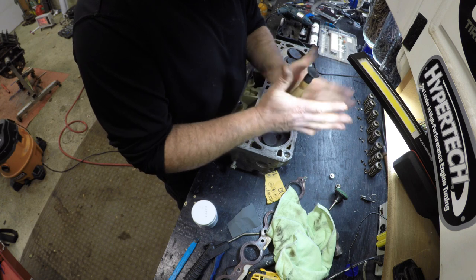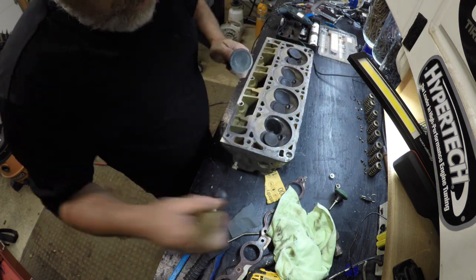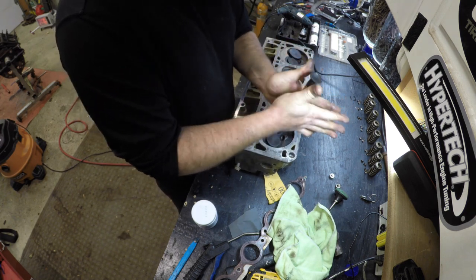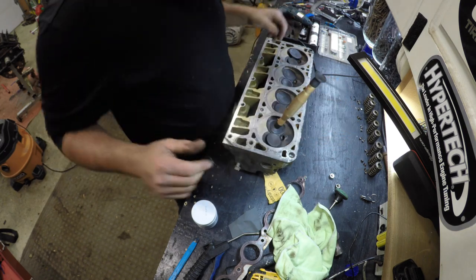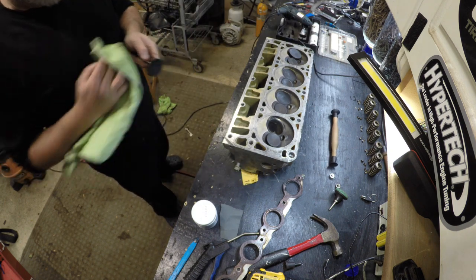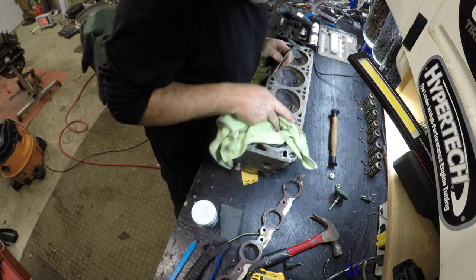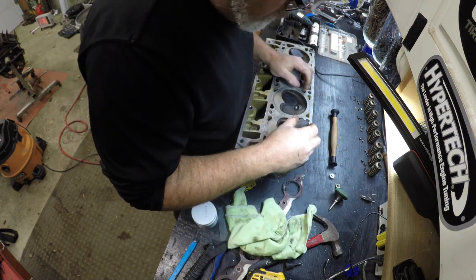It's not sticking because normally the valves are nice and clean when you're doing this. I need to clean the valves off a little better. Let's clean this valve off. I'm just going to do it three times. There we go — let's take it off and have a gander. Wow, so it looks like four times is the charm on the lapping. She looks mint.